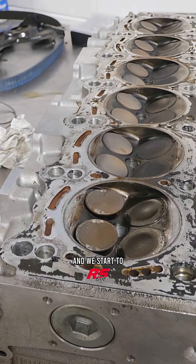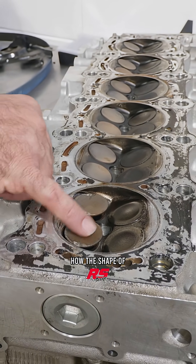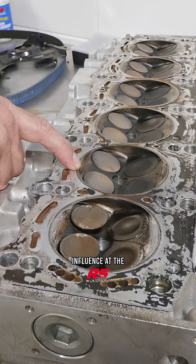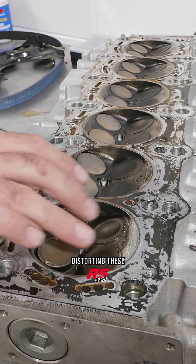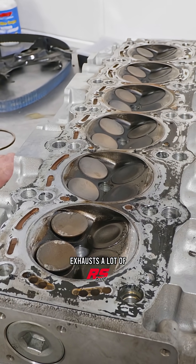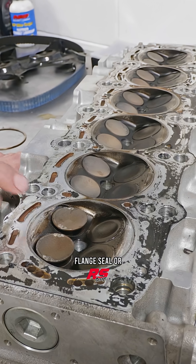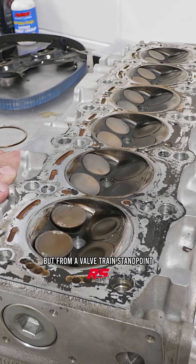As we move forward and start to talk about valve train life — how the shape of the valve job and the valve seats changes with heat and deflection — keep in mind that when you have a high level of distortion influence at the deck, forcing solid objects together, you're going to be distorting those valve seats, which in turn changes your valve job. The valve exhausts a lot of its heat back into the seat through the valve job, so if you really want to zoom out on longevity, you want the least amount of distortion at the flange seal or head gasket surface to promote the longest engine life — not only from a sealing standpoint, but from a valve train standpoint.